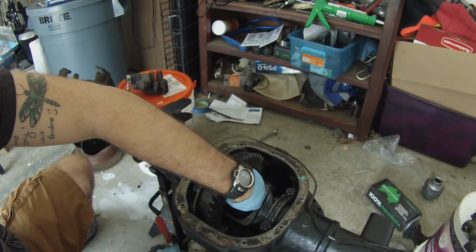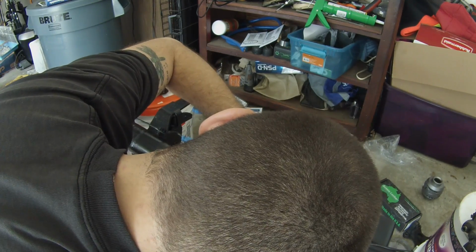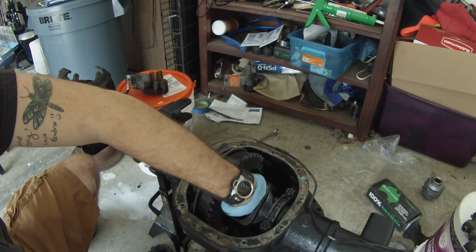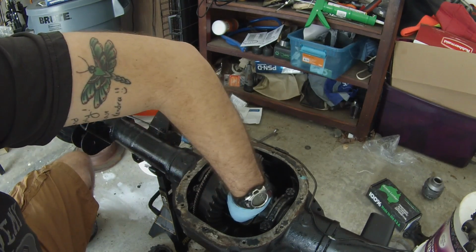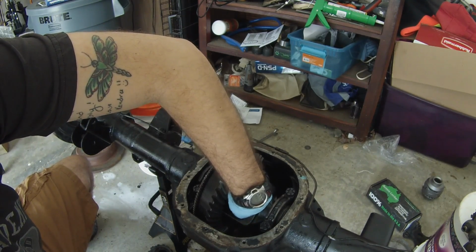And plus, in South Carolina, if it does snow here, we're shut down anyway, so it's not like I'll be going anywhere. But I wouldn't recommend running two automatic lockers in your Jeep if you're somewhere where you'll hit snow, because it can get kind of squirrely on you.